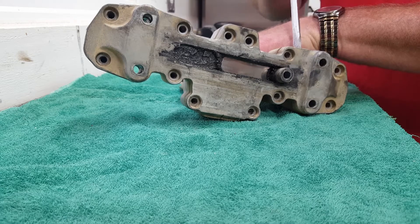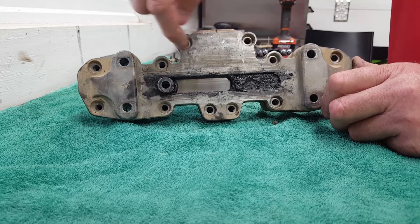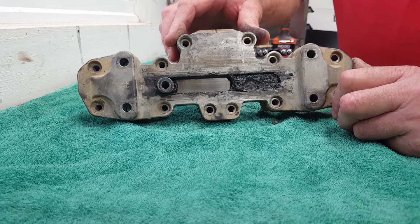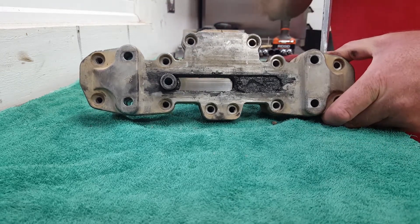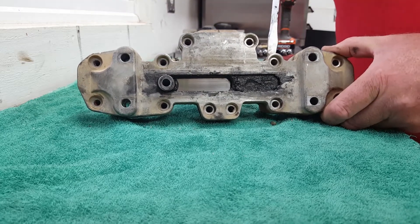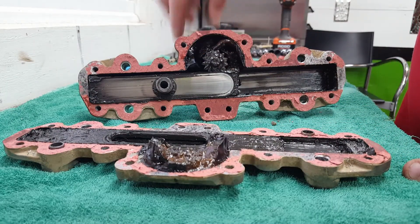It's starting to come apart. I'm betting there's hardly any grease on the main gear — it's probably packed all the way around the edges. The actual factory grease is not lithium. Lithium grease stays on the gears, stays on the drive gear. Regular grease works its way to the outer edge and the gear ends up dry.